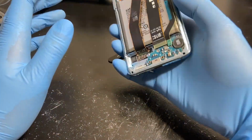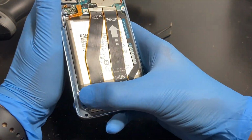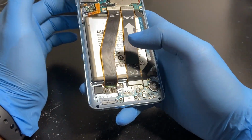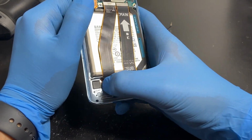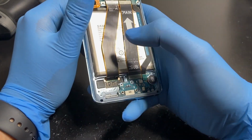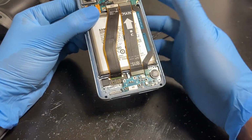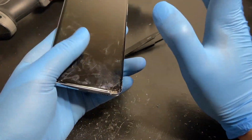I mean, it could be just the chip fried itself and then there's nothing we can do, but from what I can see, and as far as I can test with the equipment that I have, it looks fine to me. All these resistors check out in terms of continuity. I checked them off camera. Maybe there's some stuff underneath there. I'll have to remove the display entirely to check all that out, but we'll leave that for the last.